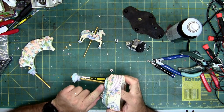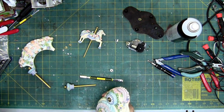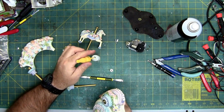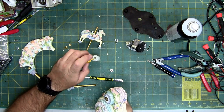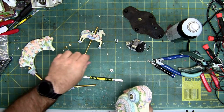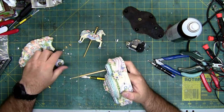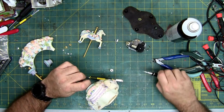Now, if you're afraid of this coming off, but you want to make sure you can take it off in the future, you can put a drop of Elmer's glue on it, and it'll hold it, but it'll allow you to take it back apart. If you don't want to take it back apart, Loctite. But if you want it to be hard but still potentially removable, where you have to use a little effort, put a dab of super glue. Super glue gets brittle. So that means you can actually crack it where you put a lot of force on it and it'll literally crack the glue.